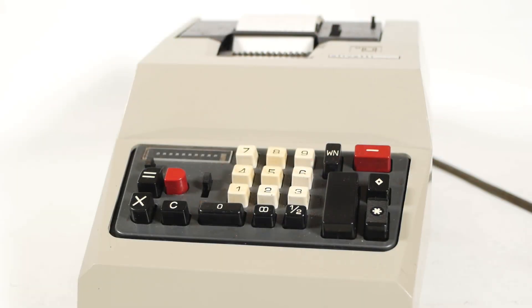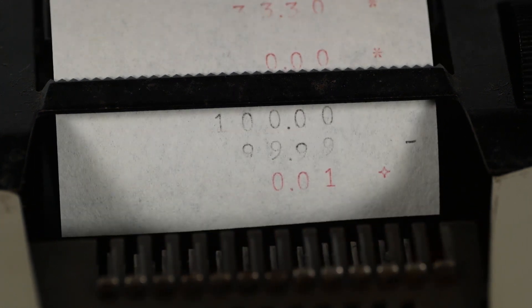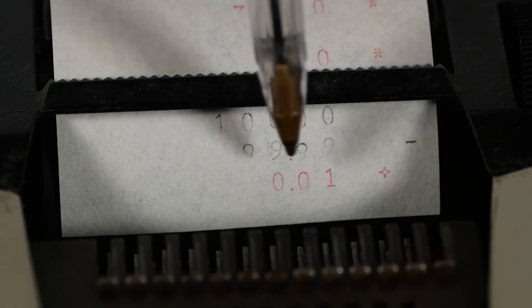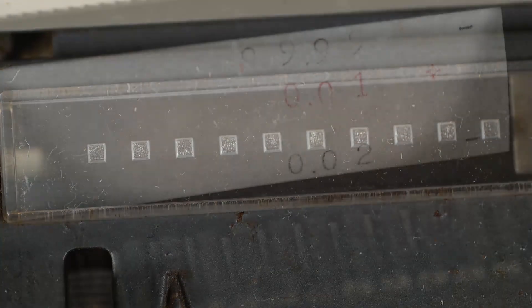Subtraction is equally simple. If I enter 10,000 and press the plus key to add it to the register, then enter 9,999 and press the minus key, it prints the 9,999 with a minus next to it. And now, if I press the subtotal, we should be left with 1. This machine has the point to separate the pounds from the pence, but if you're working with numbers other than currency, you can just ignore that point. The Olivetti machines have another neat trick: if I now subtract 2 from the total left in the register, a little flag will appear in the window up here to show we've gone into a negative result. And if I print the total, it displays a minus next to the answer.